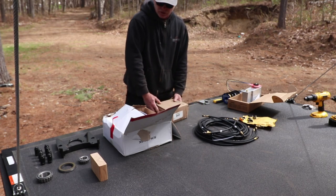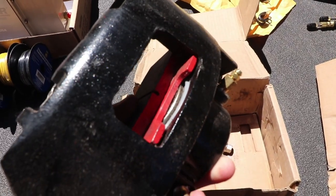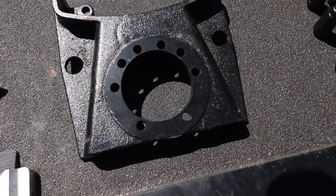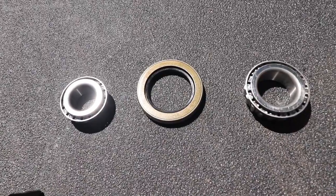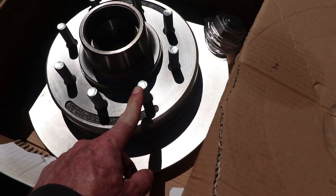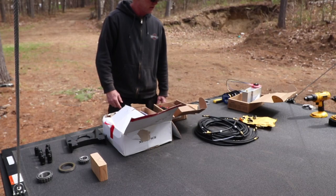The rest of the system has to do with the actual brakes on the trailer itself. That consists of the actual disc brake caliper, a new disc and hub assembly, and a bracket that holds the disc caliper. You're also going to need inner and outer bearings, a seal, and one thing I hadn't counted on was that I was going to need new wheel nuts as well. The studs on these are 9/16 inch and what was on the trailer was half inch, so I had to buy all new wheel nuts — and they aren't inexpensive unfortunately.